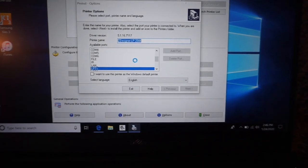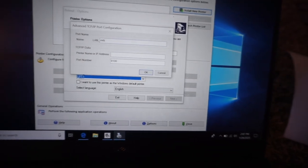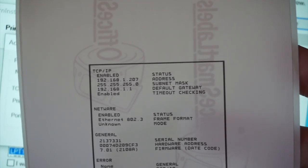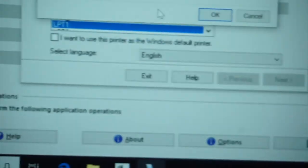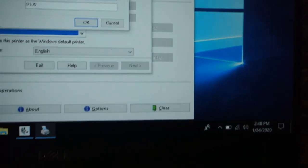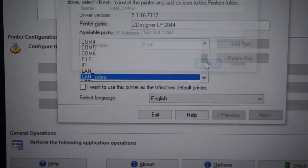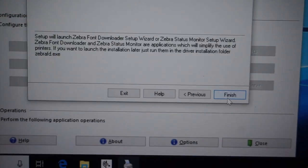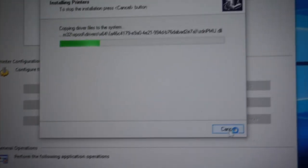It takes a while to load — about three minutes. We're going to name it 'LAN Zebra.' The printer IP address is 192.168.1.207, port number 9100. Hit OK, hit Next, don't check the fonts option, hit Finish and let that run.